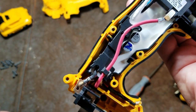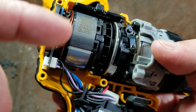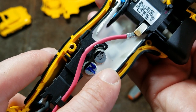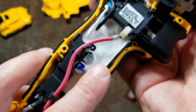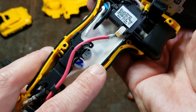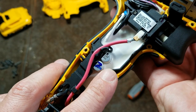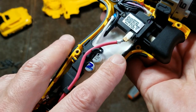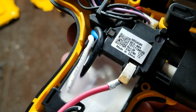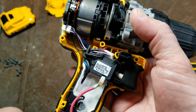For the more technical folks: we have some actually pretty large — appears to be 18 or 16 gauge — primary wire leads, and the three main power leads for the three phases of that brushless motor. What we can also see, which is an upgrade from the bigger tools, is these are metal capacitors — aluminum polymer capacitors, also known as solid capacitors. They're more expensive and a much higher grade; they can have average lifespans of 50 years or more versus standard liquid electrolytic capacitors. Premium computer electronics and gaming motherboards will have all aluminum polymer capacitors — really nice to see. That wire reads 125 degrees Celsius — a very high temperature wire, which is about as high a temp as you can get without going to oven or heater-rated wire.